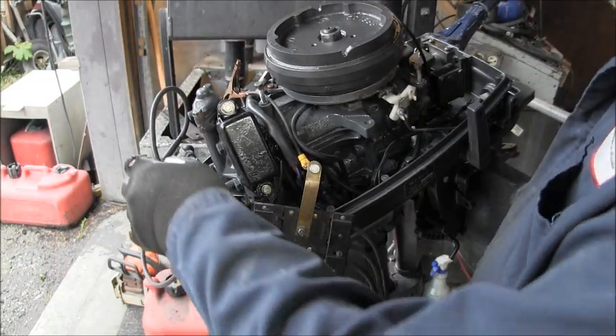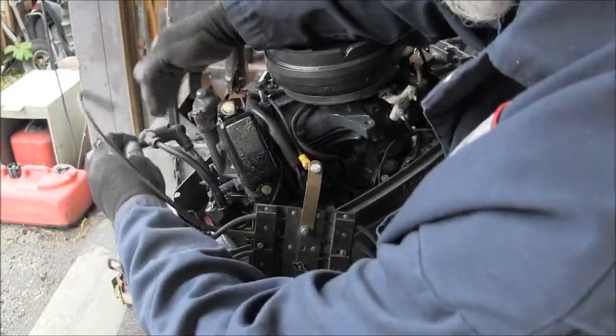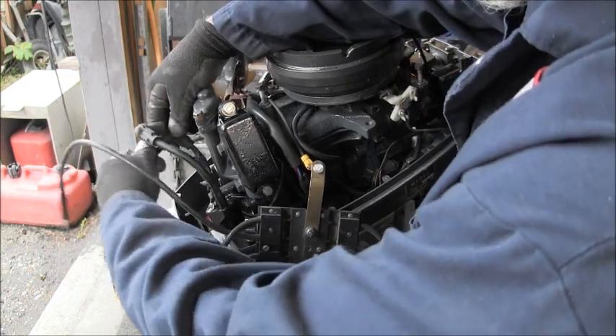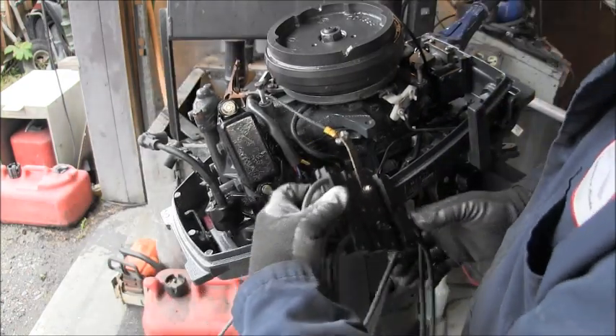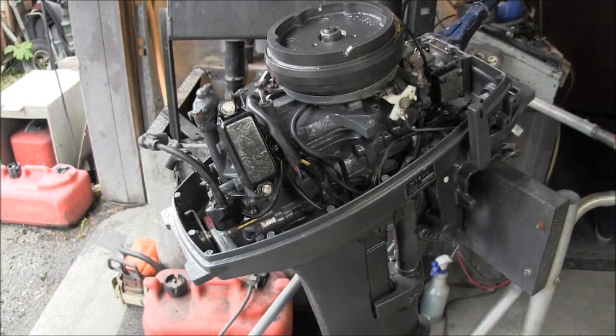That's where I soldered it, and then I put a big mound of JB Weld over that. Then I put two little zip ties here and married it to the spark plug wire itself. Put some tape here to make sure it stays, then hooked up the CDI box as designed. Painted everything there, and we got the old sparky spider on there. We got some sparky! This one right here was actually even jumping over there. It's got good hot spark now, and it sure looks a lot better after being all cleaned up.